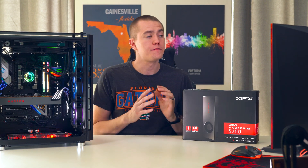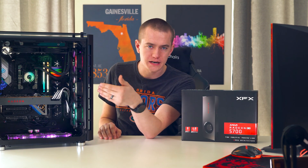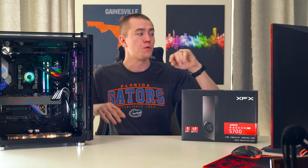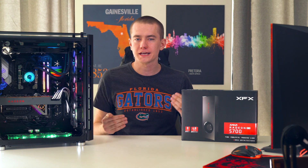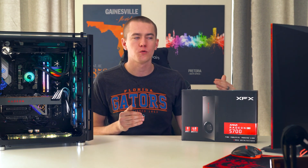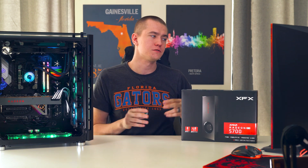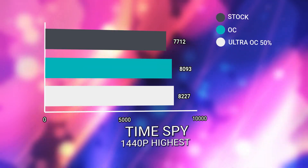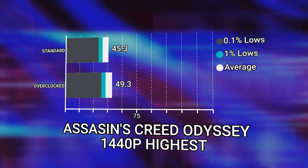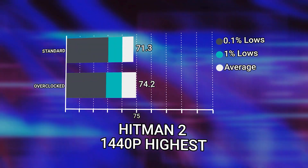Now comes the actual bit of testing. In our preliminary testing of the 5700, we did everything at stock with our Ryzen 5 3600 set to stock speeds but with RAM clocked to 3.2 gigahertz. The 5700 has a game frequency of 1,625 and a max boost of 1,725. While playing games, our average boost frequency was around 1,680 megahertz. With the AMD limit still on the card, we got up to 1,850 megahertz, but the card was actually averaging 1,780. We saw about a 5% increase in Time Spy and in video games, with our largest increase in Assassin's Creed Odyssey and our smallest in Far Cry New Dawn — an increase of anywhere from 2 to 8.8% across all tested games once we overclocked the card.